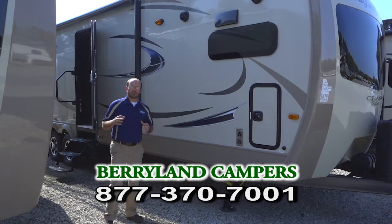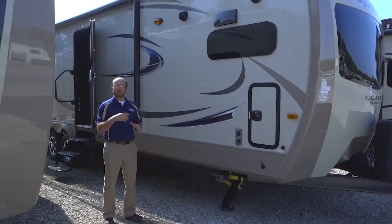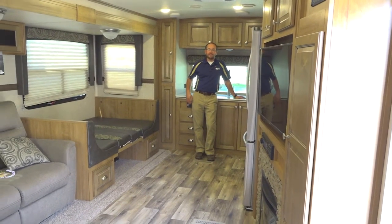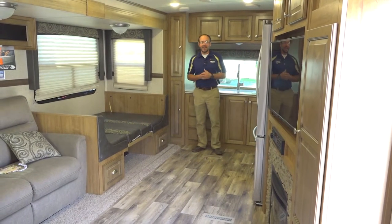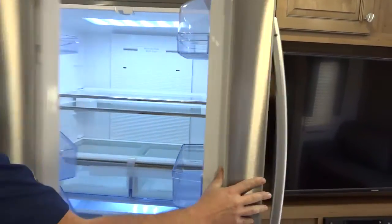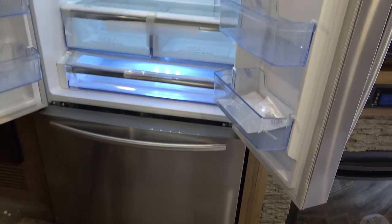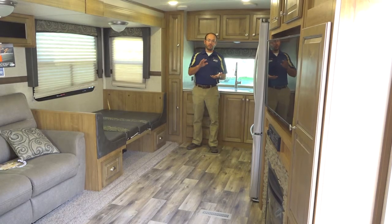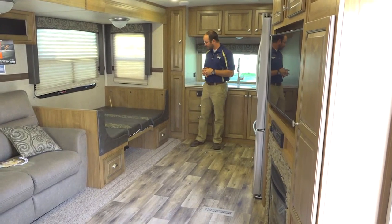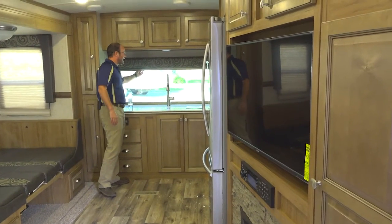Now let's talk about construction. They used to build this with a laminated floor — that's how the sidewall is built, by gluing aluminum, styrofoam, Luan, and fiberglass together. For a long time they built the floor the same way, laminating it. It works because it's lighter weight, but it also sacrificed a little in construction quality. They changed this year. It's still an aluminum frame with aluminum studs, but they've gone to a five-eighths inch tongue and groove plywood floor. I can't tell you how big that is — if there was one thing I would say the Flagstaff gave up in construction to be light, that was it.